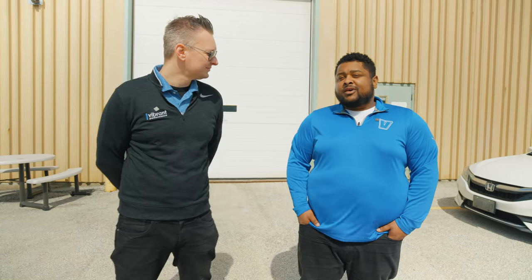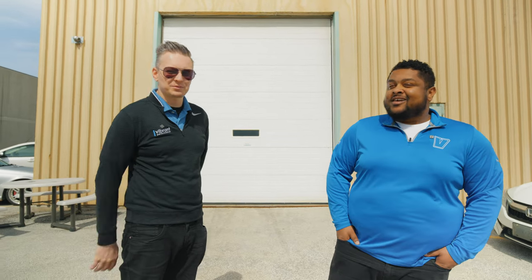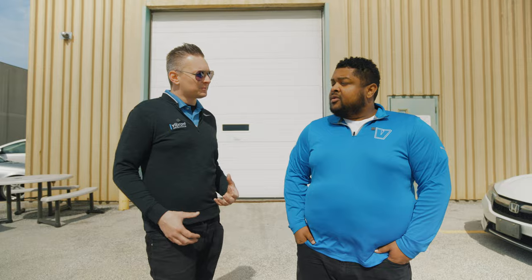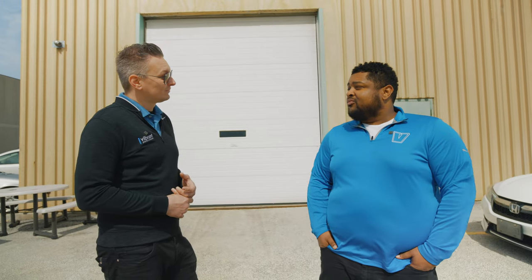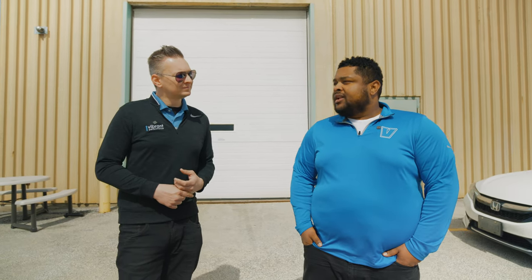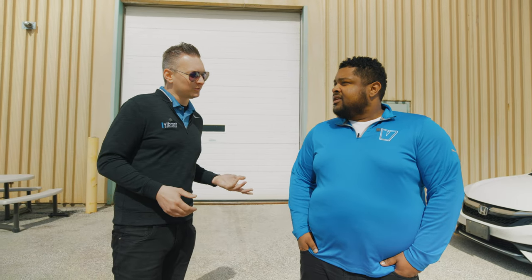The car is gone — I took it over to the body shop. It's going to get a nice wax, buff, detail, polish the wheels, touch-ups here and there. The underside of the hood got done too. Now that it's all done, what was your experience like with the PTFE hose and fittings? It was easy — not as hard as some people make it out to be. I actually prefer installing it over regular nylon braided because it goes together nice and easy. The line itself isn't nearly as flexible, but once you make sure you're routing it away from the exhaust and the sharp parts of the car, it's fine. The most exciting part is now you can run E85, methanol, alcohol, M1 — you name it — no stress.